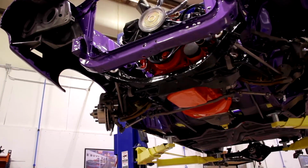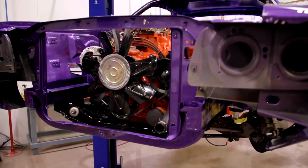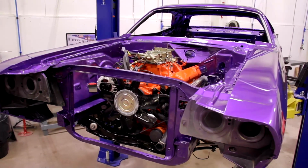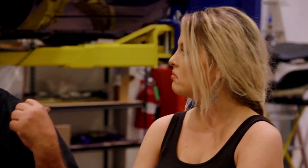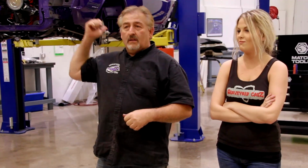The 1970 440 Six Pack 4-speed Dodge Challenger has now got its drivetrain in. It is the numbers matching original V code 440 Six Pack, 390 horsepower in '70 and 385 horsepower in '71, installed in the car with the Hemi 4-speed with the correct numbers on the side of the transmission: 677. Beautiful. That's the last 3 digits of the part number.